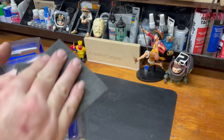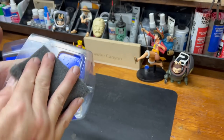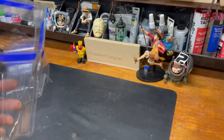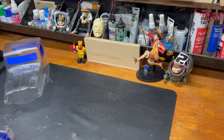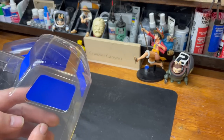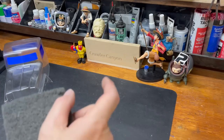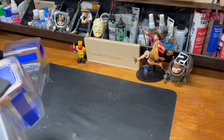This is like seven-year sign vinyl, and once its adhesive properly sets in, it is set in. If you don't have access to a Cricut, Cameo, or Silhouette, you use the power of inception and convince your wife, partner, or significant other that they really need a home vinyl plotting machine. Then you use it to cut masks, window masks, vinyl stickers, and templates - like a shock tower template cut out of vinyl, stick it on the metal, done.